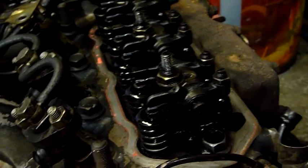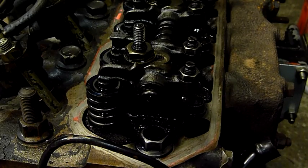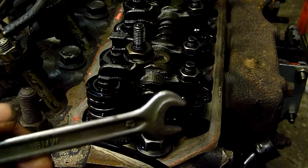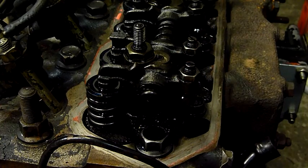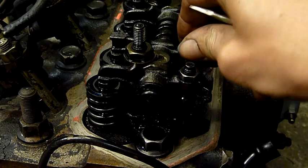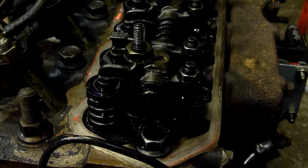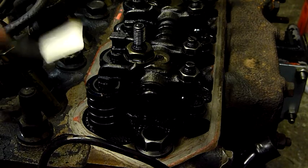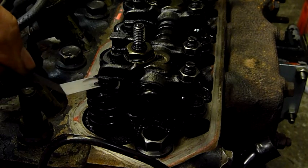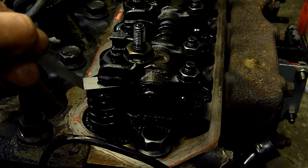This one calls for 0.2mm but my gauge is about 0.23mm so it's the best I've got at the moment — I don't know where my good gauge set is. Get a standard 12mm spanner — it's just an old BMW one but any good 12mm spanner, preferably a ring spanner, will do. Position the cylinder so that the valves aren't being operated. The gauge is a tiny bit bigger than it should be but I'm going to adjust it so it's a little bit grabby. You don't want it actually grabbing and pinching the gauge so you have to pull it out hard, but you also don't want the gauge flopping around in there — you just want a nice smooth sliding fit with a little bit of resistance.